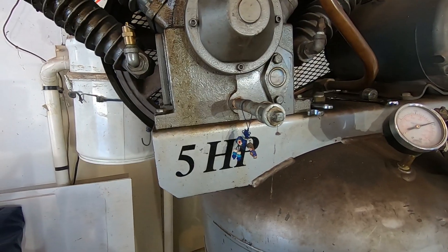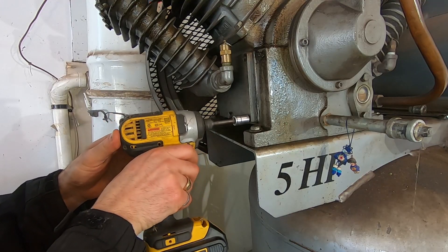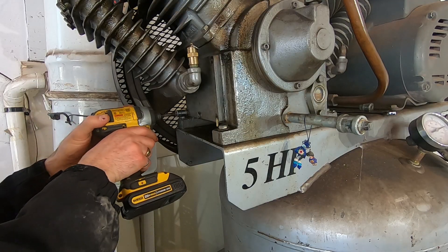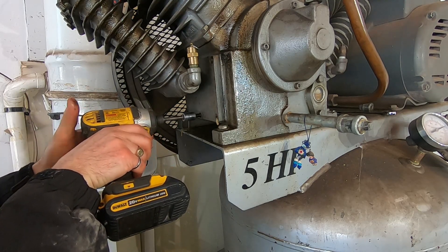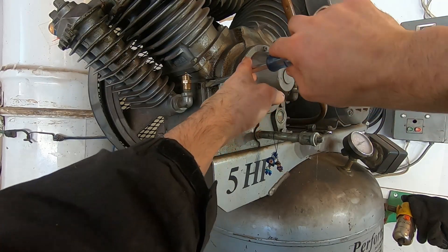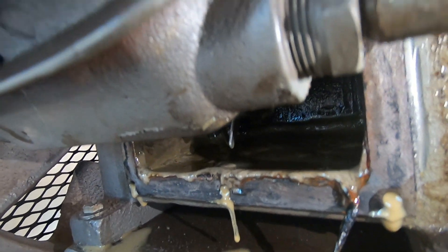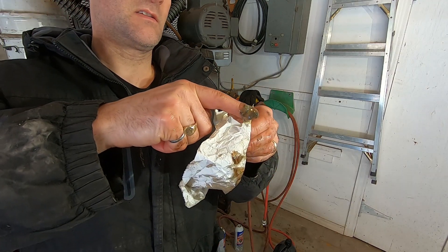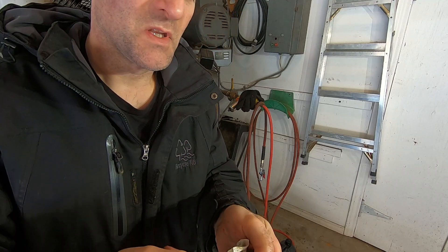There's the caramel sauce. So the next thing is to take this plate off — as soon as we take these bolts out they may start to leak. There we go, drip, right in the pan. I'm trying to save this gasket, so I'll be careful. It's not healthy looking — there's definitely debris you don't want in there. I just scooped up a bunch of that. It's got strings of debris in it, and that is all what's in the bottom of that crankcase.